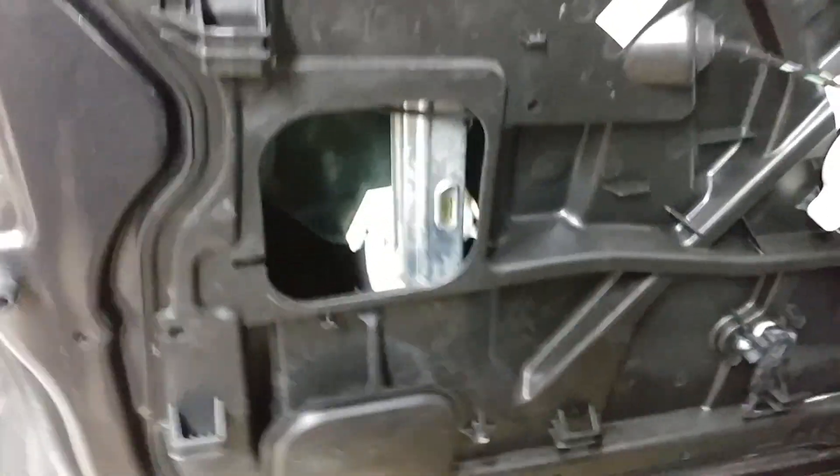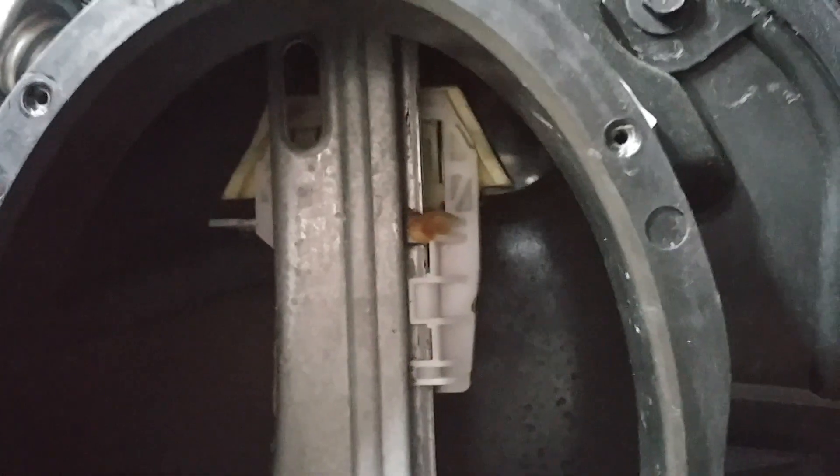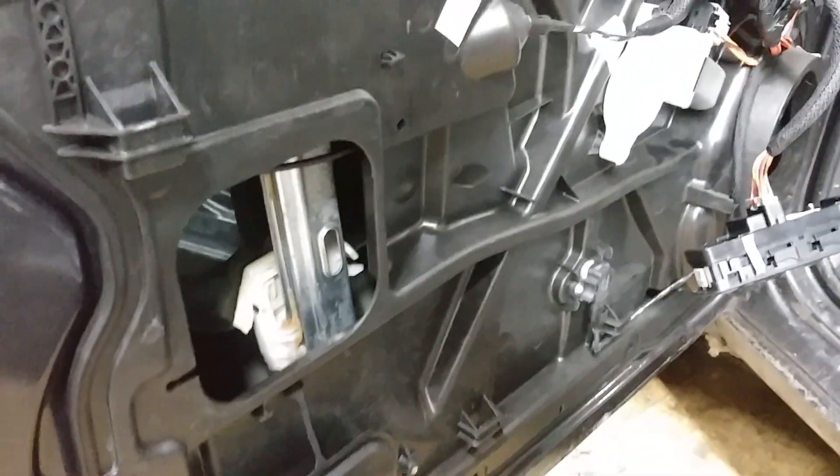What was confusing in here is the tab — I don't know if you can see that tab back there on the other side of the glass, but I couldn't figure out which side of the glass to put that tab on. Apparently it goes on the outside, the vehicle side, so it's on the far side of the glass, and the same on the other side of the door. Once I got this side behind the speaker dropped in place, the other side just fell right in place. There's an actual hole in the glass and a tab that falls into that hole, so you can literally hear it snap in on both sides.